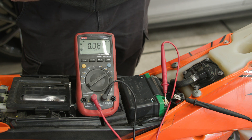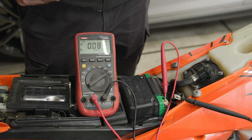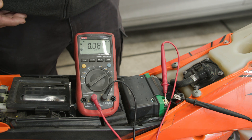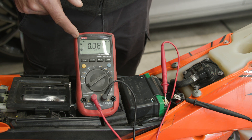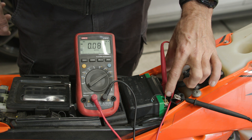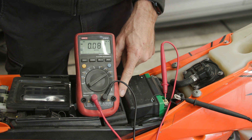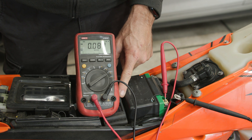If your bike does measure high levels and is having problems starting after a week or so of storage, that would indicate that something is drawing excessive power. What you can do is, for example, if you've added an aftermarket navigation device, disconnect that and see whether the current changes. If it does, a workaround would be instead of connecting directly to the battery to use a switched voltage supply - a relay switch or a mechanical switch. On a 2024 model it does have an ECU-controlled solid state switch which you can use to power certain things.